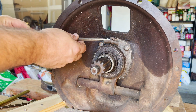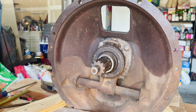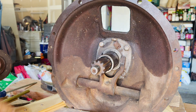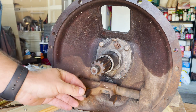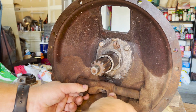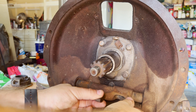Now we're going to move to the front of the transmission. Here we're releasing the spring that returns the clutch disengagement bearing — the throwout bearing — and its own housing. That's the fork that, when you press the clutch pedal, rotates forward and moves that throwout bearing to disengage the clutch from the engine. We're eventually going to take that out, but not right now.